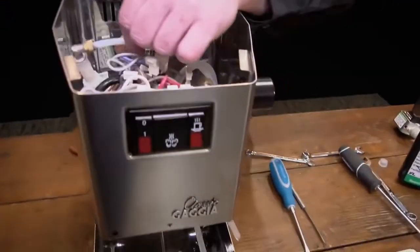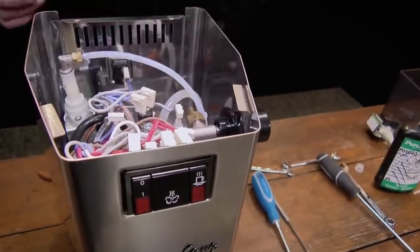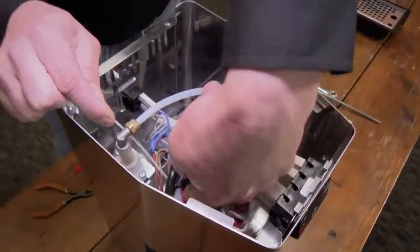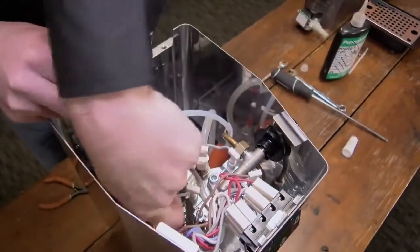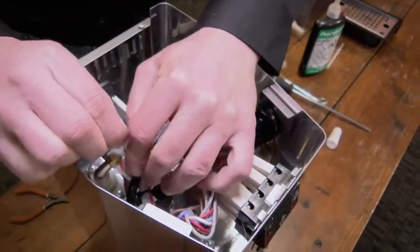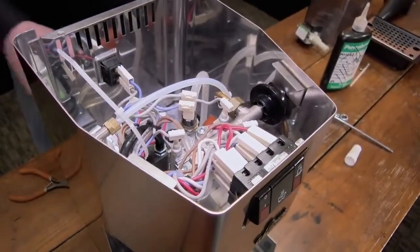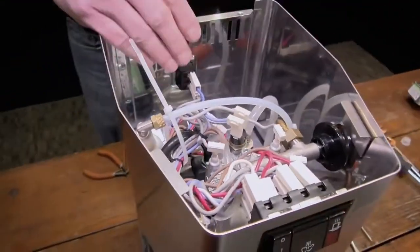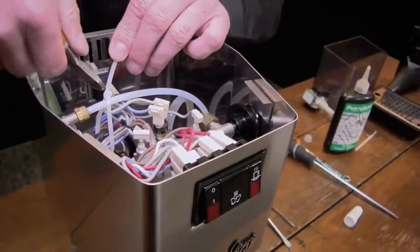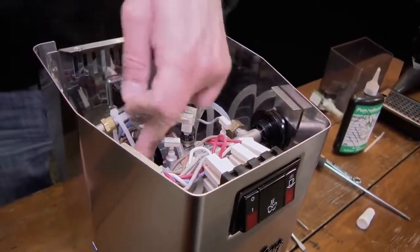The last thing I like to do: the pump flops around a little bit, and if you're moving the machine around the funnel can hit the top of it. So I'll just run a zip tie around this bunch of wires. You don't want to go too crazy tight — you don't want to put a lot of pressure on them. But you can see how it holds the wires back and keeps them from flopping underneath the funnel area where they can vibrate and hit the funnel. I always do this whenever I repair a machine. Cut off the excess — it's not going to hurt anything.